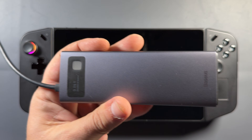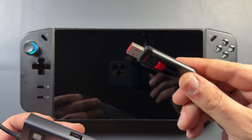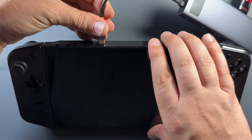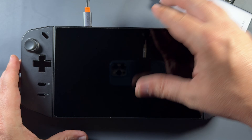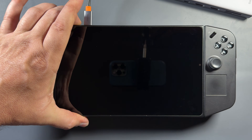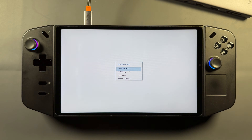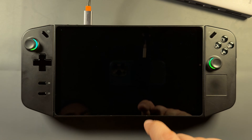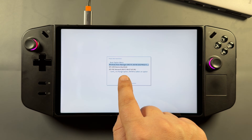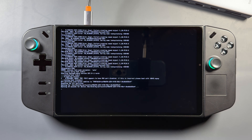I went ahead and shut it down. We're going to get plugged in — I have my USB hub that I'm going to use. Whatever you want to use to attach the media you created with your USB flash drive. I'll plug that in, then take the USB-C from the hub and plug it into the Legion Go. Just like before to get into the BIOS, hold Volume Up and turn on the device. This time we're not going to go into BIOS setup — we're going to go into Boot Menu, which will allow us to boot from the flash drive and install SteamOS. I can see my SanDisk USB flash drive right here, so click on your media.